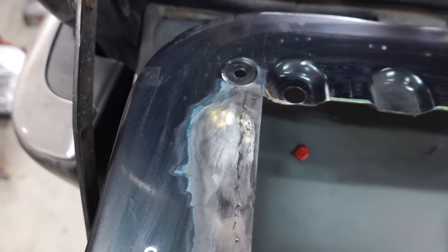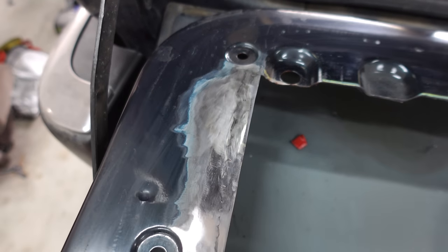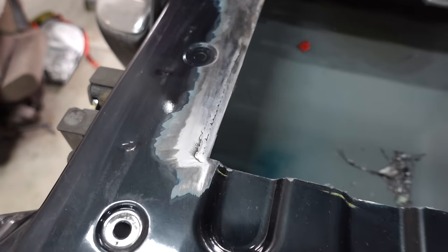I got ahead of myself and cut the hole a little bit too big. You're supposed to leave a quarter inch around the perimeter so the lid has something to sit on. I used my marker, pushed away from the edge to make a line, then cut outside that line — but it ended up only being about an eighth of an inch. I didn't measure it, so now I'm having to go through and add more material to make this fit perfectly.